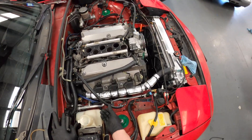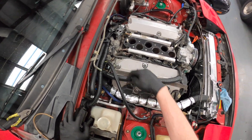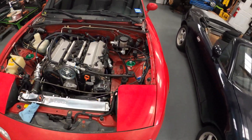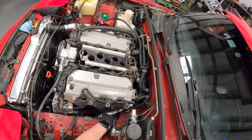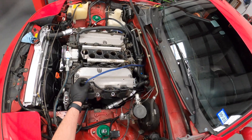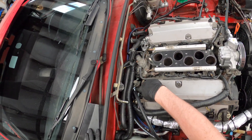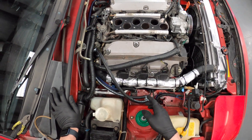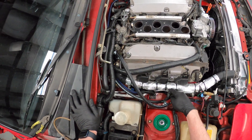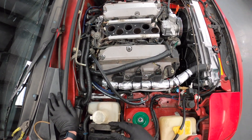We have one fuel line on here right now. One of the fuel lines out of two, because the other one doesn't match the size over here — this is quarter inch and that fitting is definitely not quarter inch, so I've got to figure out what to do about that. I did the same heat shielding on this side as well — anti-chafe down here and back there, which will help since it's going to be very tight up on the manifold. I tried out the 5/16 line to see if I could clamp it over here, but I'm not keen on how tight I had to put it to keep it from leaking. The size on this is definitely quarter inch and the size in there is definitely 5/16, so short of putting an inline adapter, I don't know how we're going to get a reliable connection.